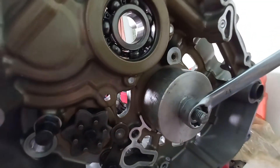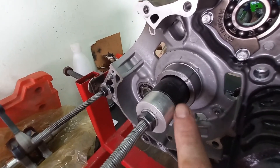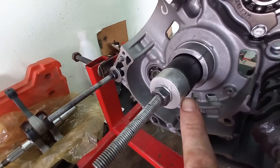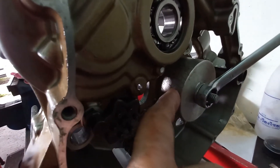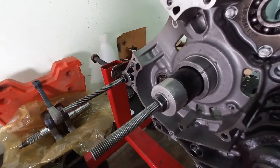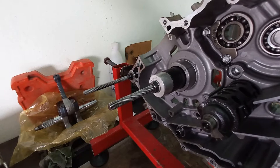I've got my receiving cup on the back - it only needs to be flat on insertion. On the front side we have the tool set up against the marks with the 27mm socket. To push the bearings out you need a 37 millimetre pusher, although you need a 38 to put them back in. The reason you need a 37 is there's a little collar under there and it's only 37mm deep, but if you try using the 37 to put them back in you'll mar up the side of the bearings - I know that because I had a practice with the old ones. So we are now going to draw those bearings back in after putting a load of lubrication on them.